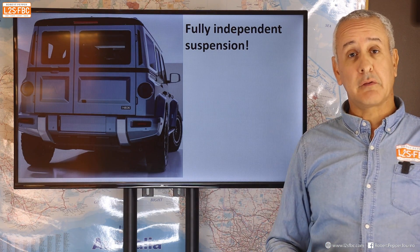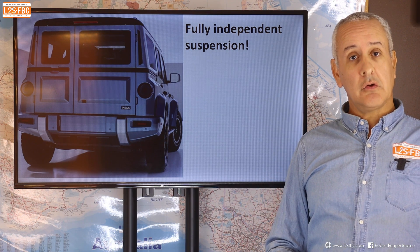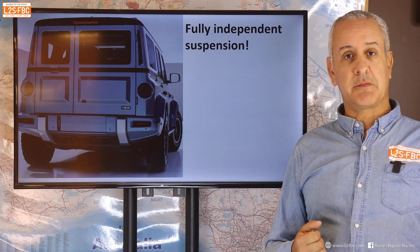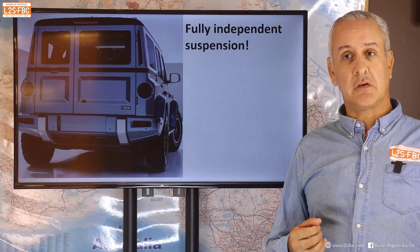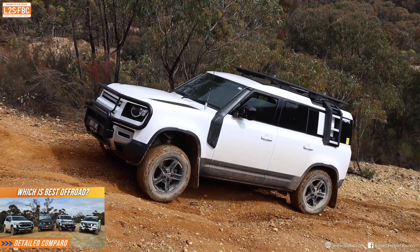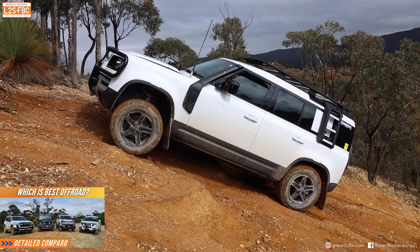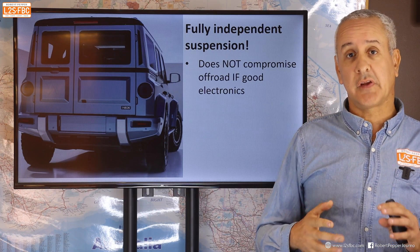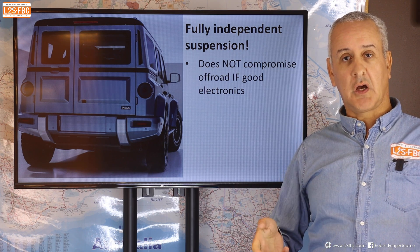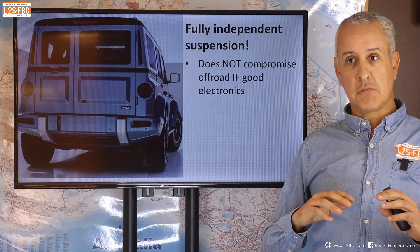The Fusilier does have fully independent suspension. I know you might think that means it'll be less capable off-road, but no — not necessarily. You only need to look at the Land Rover product, specifically the L663 test versus the Grenadier, LC300 and Patrol, where the L663 was in no way disgraced. Land Rovers are really capable off-road and they're now fully independent suspension. However, the caveat is you have to have really good electronic engineering to make independent suspension the equivalent of live axles off-road, and so far Ineos have not demonstrated much capability in that.